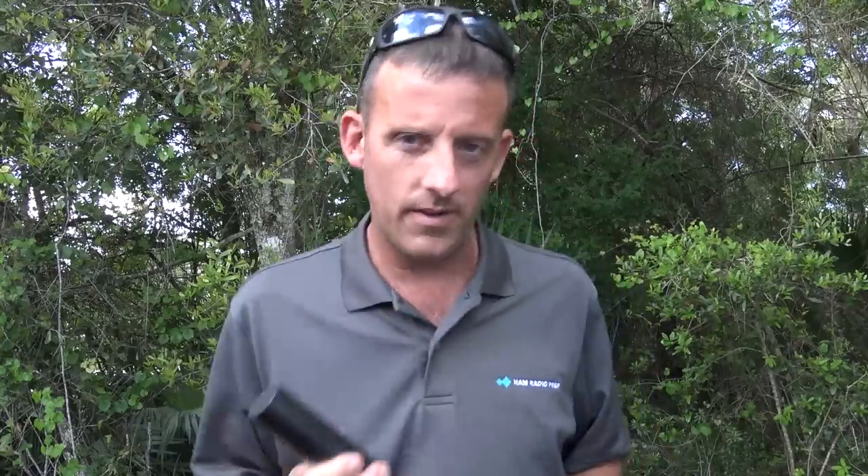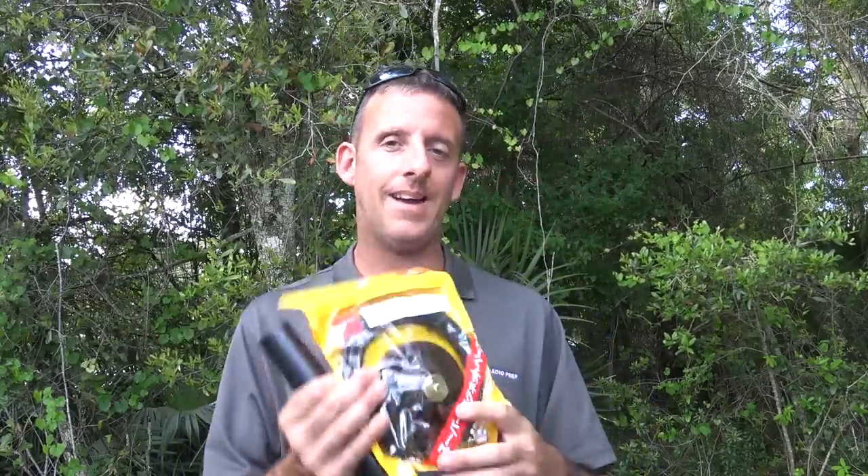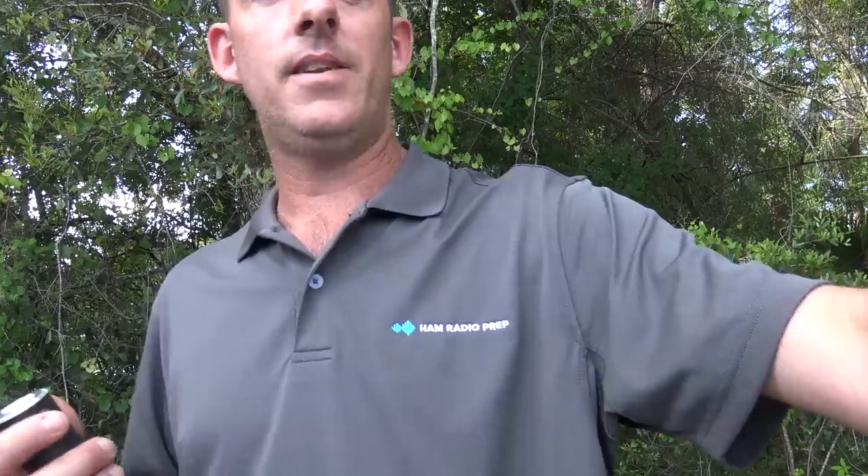You do not have to put an analyzer on here and adjust it for lowest resonance. The idea is you get the lowest SWR with the best installation and the best spot for your mag mount on the vehicle. You don't need to take anything apart — if SWR is a little high, try moving it a bit, but follow the instructions and get it in the corner of the roof. It won't damage the radiation pattern — it's not making it directional, just coupling with the vehicle.